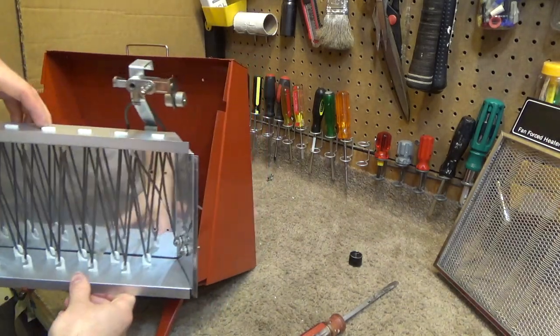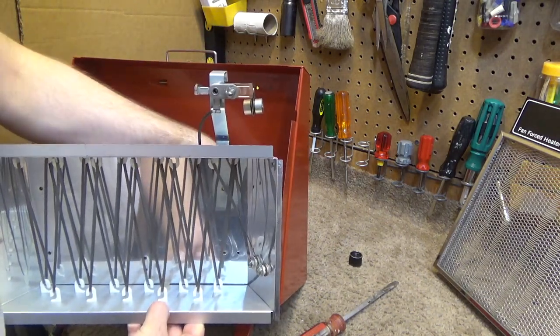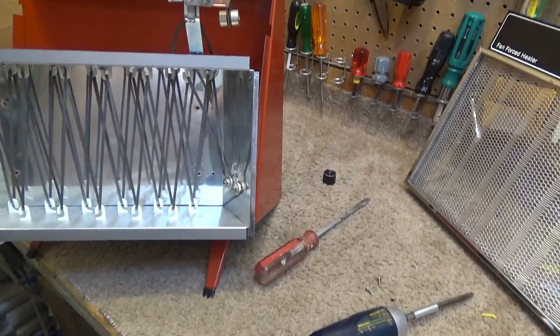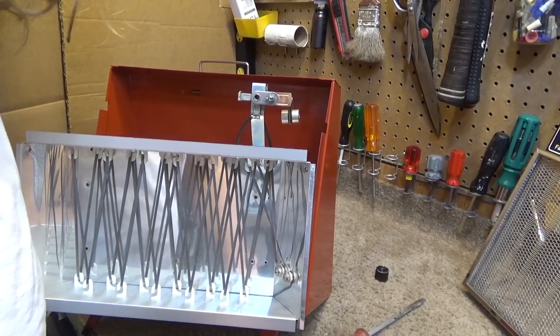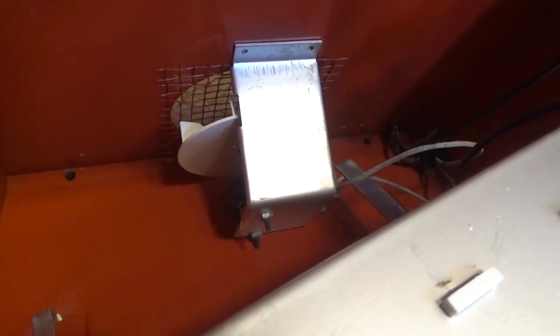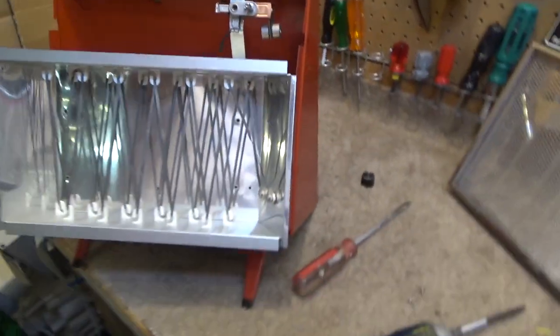Looks like there may have been some hackery done in here at some point. The mains line is all just taped together. It's kind of odd. It doesn't seem like this has any even hours on it. Don't like that at all. Maybe have to redo that. It's always good to check this stuff when you get it used. Oh, the fan doesn't even need to be serviced. In fact, this fan is probably easily replaced with one of those cheap bathroom motors or something. Probably should put a couple drops of oil in there anyways though.